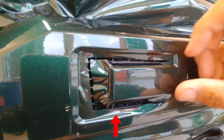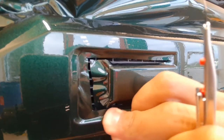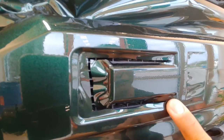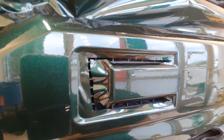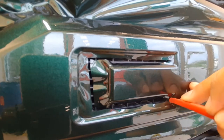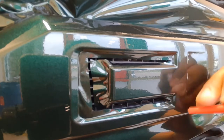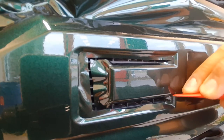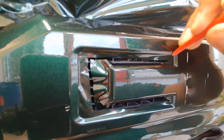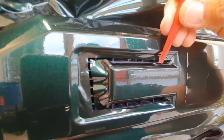I'm not wrapping all the way in — basically wrapping to where it angles in and then drops into essentially a 90-degree flat going into the emblem itself. On the far right side I'm giving a little relief cut, cutting in the middle of the vinyl of the letter so that I have a relief cut to move the vinyl inward into the emblem. Once I have the emblem lined out, I'm using my micro squeegee to make sure I have a good defined line, because that's where my blade is going to cut, lined up against the ledge of the inner part of the emblem lettering.